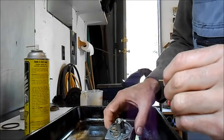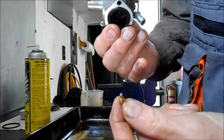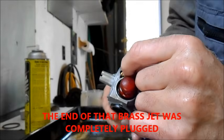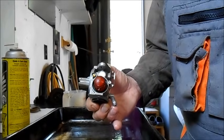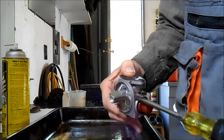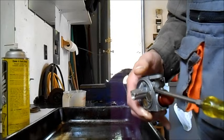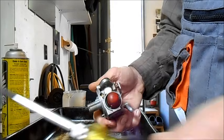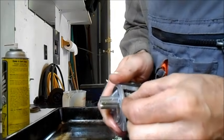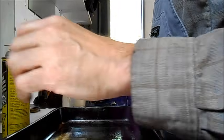I think I found a couple of clogs. There was nothing wrong with the emulsion tube, but I did find a clog in the idling circuit. This goes right in here on the side — we'll turn it in with a screwdriver. Now this goes in hand tight; you don't have to worry about setting that orifice or anything. This piece of plastic cover goes over top just so people don't muck with it. We'll continue putting it back together.